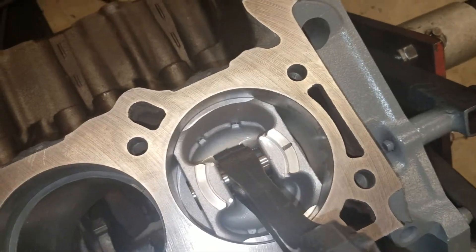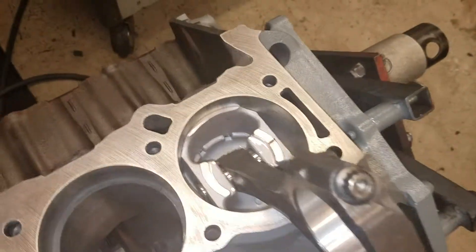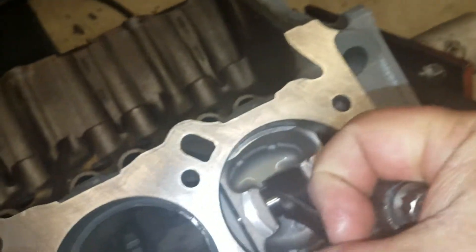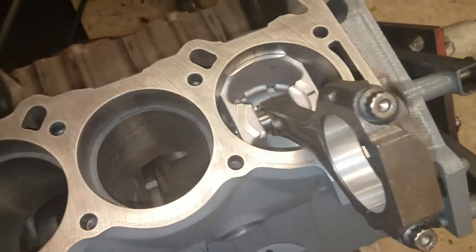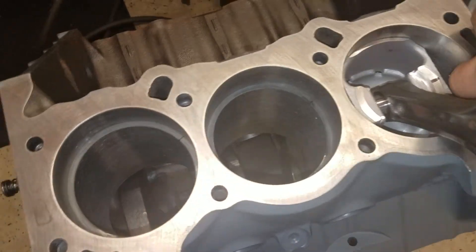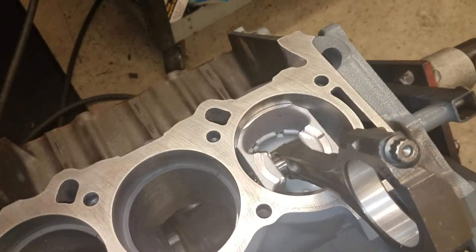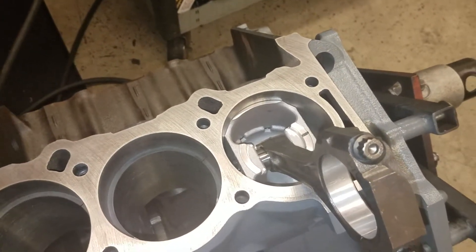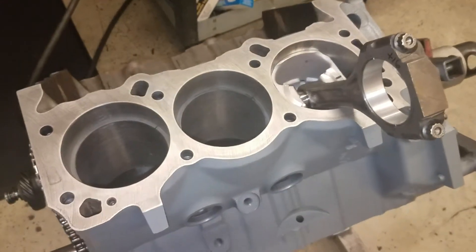I have the piston in upside down — upside down because I've just put the oil rings on it, the expander and the two oil rings, and I want to feel the drag. Yeah, we got drag there — there shouldn't be a problem with oil control on this motor, this should be good to go. This check is very important just to verify you get the right rings. Stuff gets packaged wrong, people miss things, we get complacent, we stop checking things, and then you get bit. We're good on this motor — it's time to go ahead and put all the pistons in.